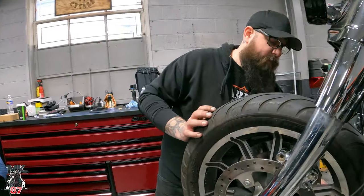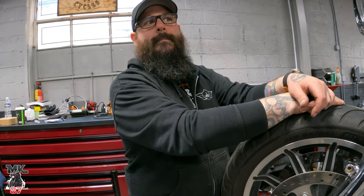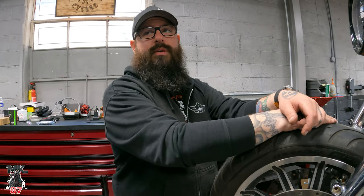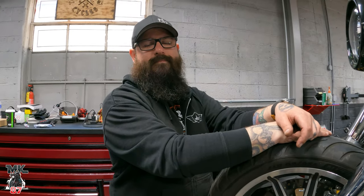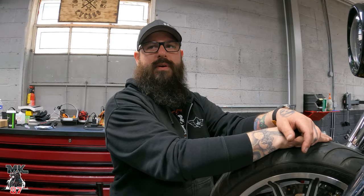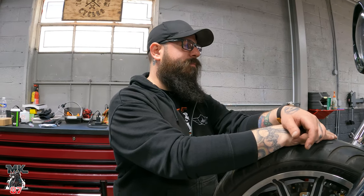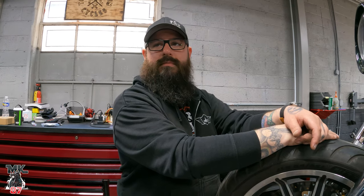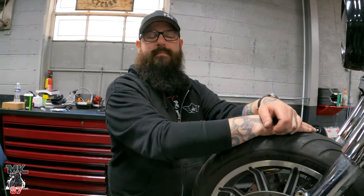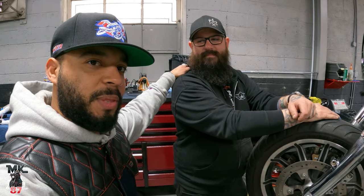Mike, real quick. The break-in period with the 128 kit, 1,000 miles we needed, right? Yep, 1,000 miles. Nice, easy riding. We had the rev limiter set low, so we couldn't really over-rev it or cause problems. It was also detuned very well because it couldn't hammer on the dyno. 1,000 miles is through. We got fresh oils back in there, and it's fully ready to go. Pretty sweet. If you guys want this guy right here to build your next 128 kit, he's here waiting for you with a big, nice smile.